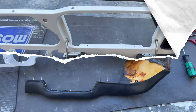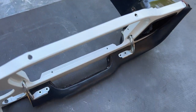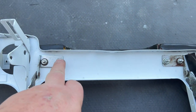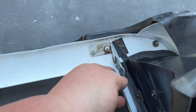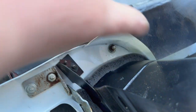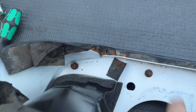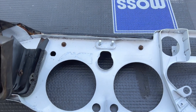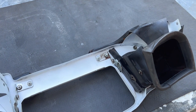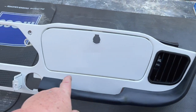The lower crash pads are installed on both sides. On the passenger side it picks up the glove box hinges and one more in the corner down here — we'll glue that down afterwards. On the driver's side there are three pickup locations to bolt on the back of the dash. If you ever need to exchange those out, you basically have to unbolt them from the back of the dash.